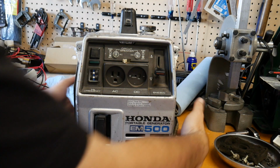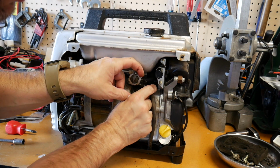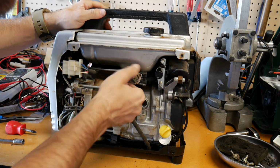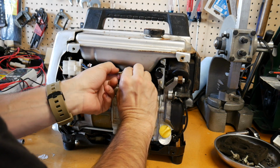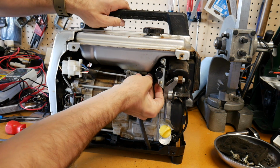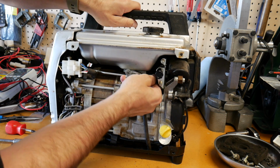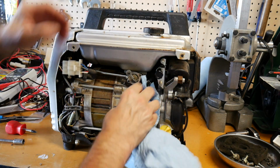Okay, so that's off. Now we'll unhook the vent or breather right here. And let's make sure we're off. So it's off now. Now I've got to carefully unhook this guy right here. That's off. And then we'll pull the fuel line off. It'll probably leak a little bit of fuel, but obviously the valve does work. Oh, yeah, we got a lot coming out there, huh? Oh, man, I didn't realize.